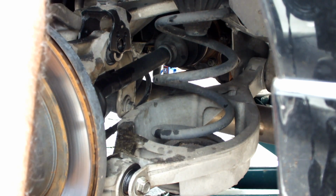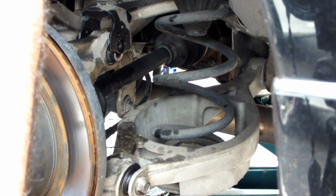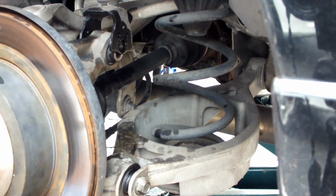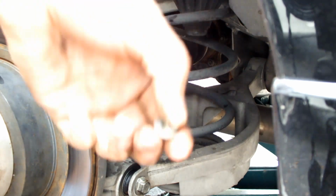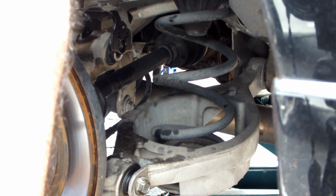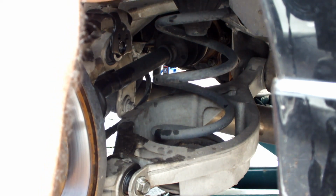which you use a 14mm socket and a long extension. So those bolts aren't really tight. If I remember the manual, I have it written down, so I can show you guys. In the manual, I believe it said it was a very small bolt nut. So these don't actually get that much torque. I think it's like 20 foot-pounds, which I have to convert to inch-pounds because my torque stick only goes up to, I think, a minimum of like 40.